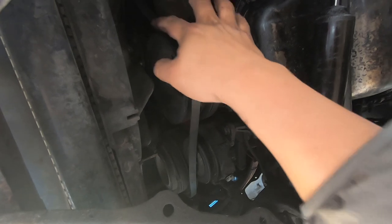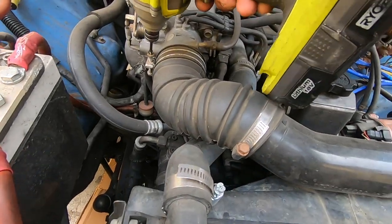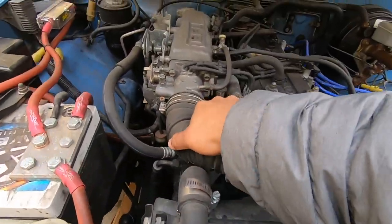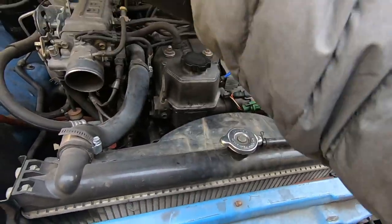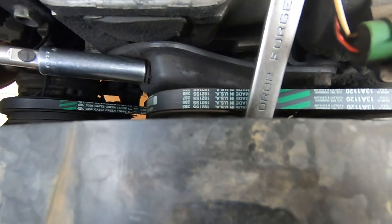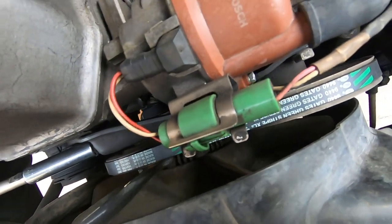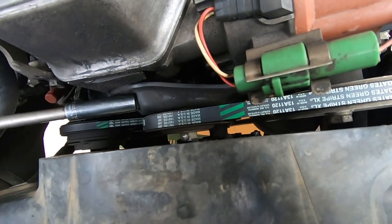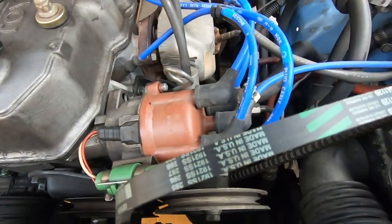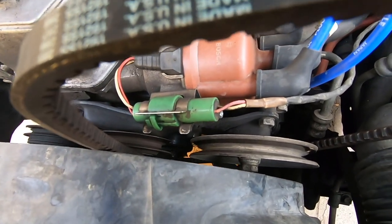I'm about to go to the top and remove the power steering. To get a little more access we're gonna go ahead and remove the tube — it's just a Phillips or 10mm right here. This one is a 12mm and the one on the pulley is a 19mm, same as the other pulley down there. We're just gonna loosen this up a couple of turns, then keep backing it off until we can remove the belt. The AC belt we were able to just toss it down and it fell out, but for the power steering pulley we're not able to pull it all the way out because of the clutch fan.